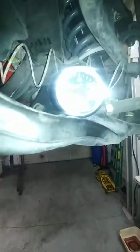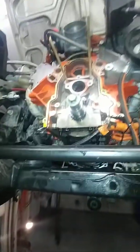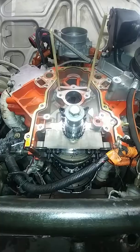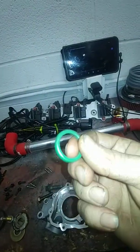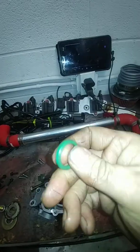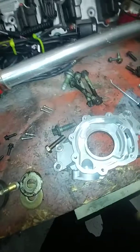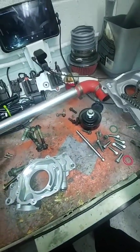If this is still showing low oil pressure, go to the oil pump and O-ring. You've got to take the whole front of the motor apart to get to the oil pump. Check the O-ring. In this case, the O-ring was still brand new — this motor only has a few miles on it since the full build. Open up the oil pump if the O-ring is still good.